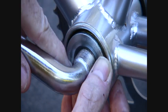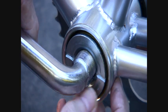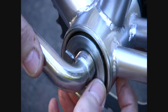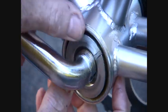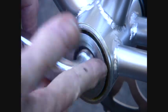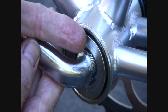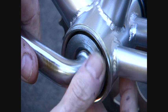The cone is the same thing — left-hand thread. So to unscrew it, we turn it backwards of the usual way. Let's just unscrew it backwards. I'm going to hold this — I don't know whether there's caged bearings or loose bearings in there, so bear with me. There is a spanner tool for turning this, but if you needed help, you just make a drift — that is, a punch — out of soft metal, aluminum or brass, and tap, tap, tap. Because not all bicycles are new and lubricated; this stuff gets pretty cruddy.